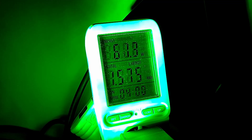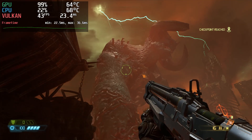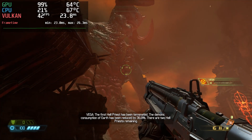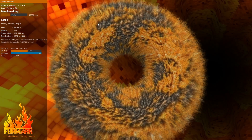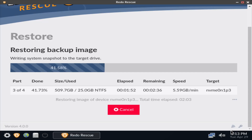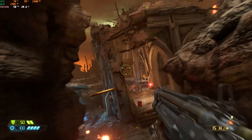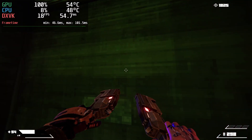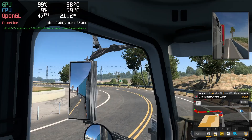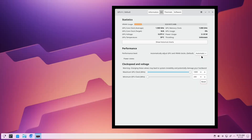Power draw reaches around 60 watts in a demanding game — that's about the highest I've seen. I then tried installing Steam and running some games, and I was not impressed. I ran FurMark to compare with Windows — that's about two thirds of the frames per second compared to Windows 11. I restored Windows and confirmed games run 10 to 30% faster there. I installed Arch to rule out it being an OpenMandriva issue — no difference. No difference between X11 and Wayland either. I tried setting the power profile in KDE and LACT, Game Mode, and RyzenAdj, but none had any impact.